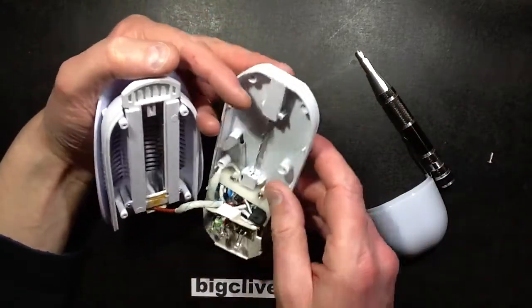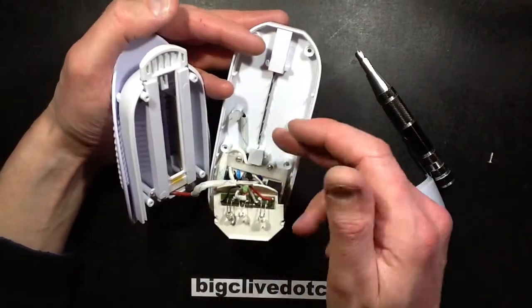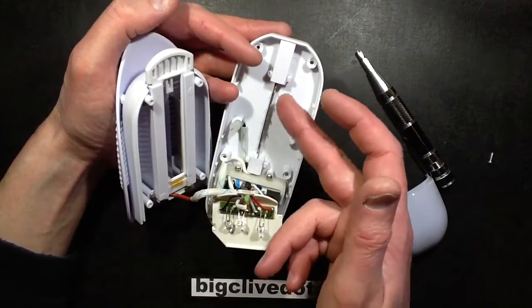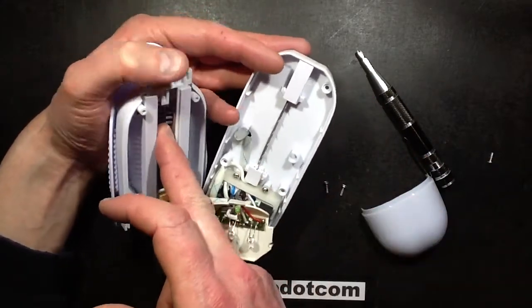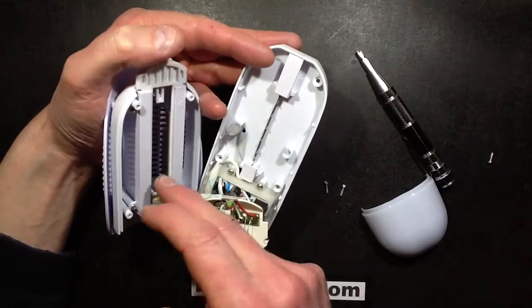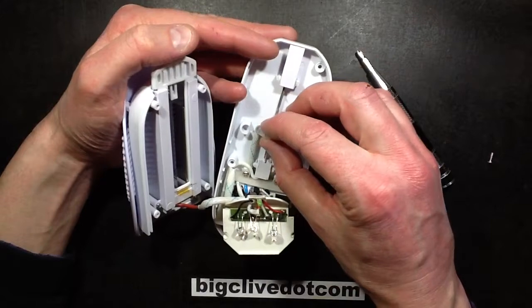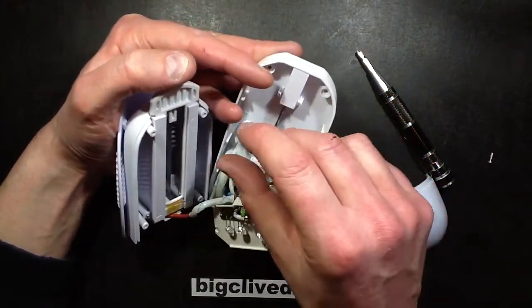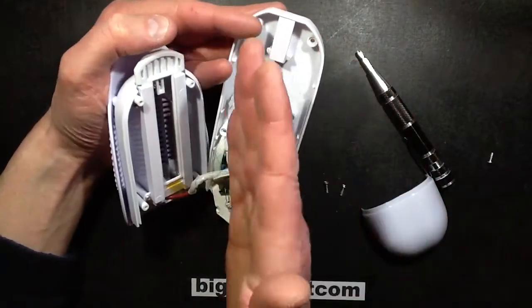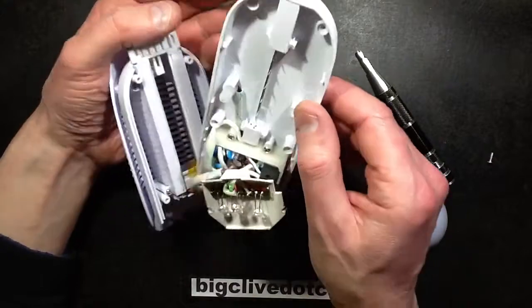Some of these units that's all they have, and they say it's also an ionizer — but it's not really, because any negatively charged air molecules from here will automatically get attracted to the positive plates and nothing would go out the front. But it's interesting that they've actually got this little rubber bung with a needle in it, which is generating the ions separately, and it's outside that field with an insulating plate.